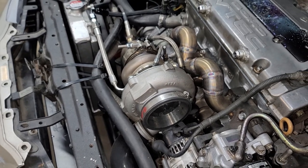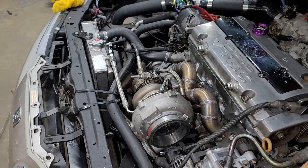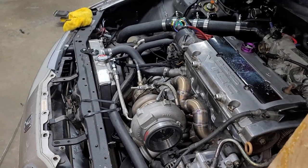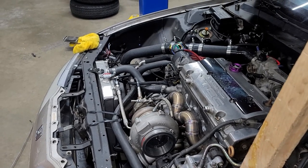You always want to build higher than your horsepower goal — that's probably rule number one, which is why you're asking yourself this question and getting your foundation set. So if I want 350 horsepower, I want a turbo that can make 450.